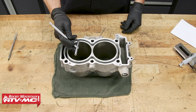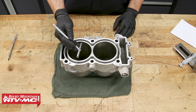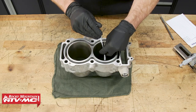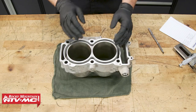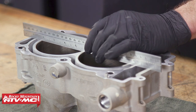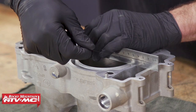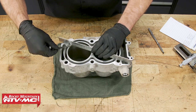To take these X and Y measurements, I'm going to use a snap gauge and micrometer. If you have a dial bore gauge, that's probably your best and fastest option, but a lot of guys aren't going to have that so we're going to do it the old way with the snap gauge. When you do it this way, you want to take several different measurements in one position to make sure you're getting a consistent and accurate reading. Once we've taken these measurements and if nothing's out of spec — no too much taper, too much wear, or too much out of round — we'll check it to make sure it's not warped. To check our cylinder for warpage, we're going to use a straight edge — a ruler with a machined edge — and then a feeler gauge at the service limit, which is two thousandths of an inch. We're going to try to insert this at all the spots all the way across the ruler, and then we'll also check diagonals. If you exceed the service limit at any point, you know the cylinders need to be replaced.